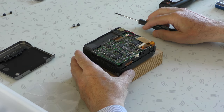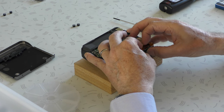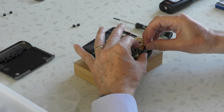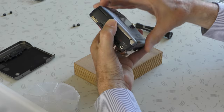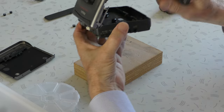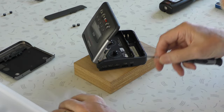The next thing you do is loosen those clips from the flat cables — and this one. Be careful, they are very brittle. Here is some glue that you can loosen. Then you open the lid, the top plate. Because there are also screws in here. I assume there is no battery in it. The DCC Museum has good spare batteries for you if you need them.